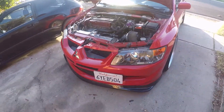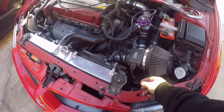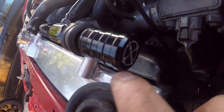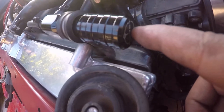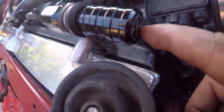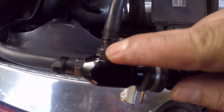All right, I came back from the test drive around the block - it's good. With it turned all the way out it was running 12 psi. Then I turned it two full turns around and it was still at 12 to 13 psi. I turned it two more times and it went up to 15 psi. Then two more turns and it went up to 20 to 22 psi and tapered down to 18 psi. It works!